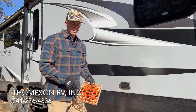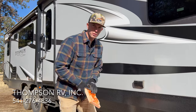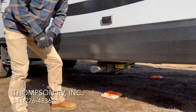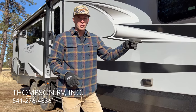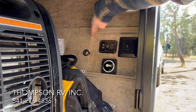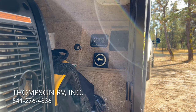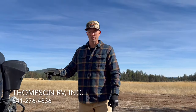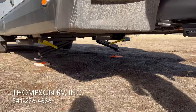I like to stick one or two of these underneath each of the jack feet, just so that jack foot's not pressing down hard in the mud. There are also rubber chocks, snap pads, and a bunch of different options you can use. So I'm going to line that up with that jack foot — we may need to move that a little bit when we get ready to auto level. In the front storage compartment, I'm going to press the up and down arrow together to turn on the keypad. Next, I'm going to hit auto level and the trailer is going to level itself out.